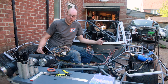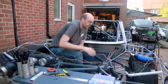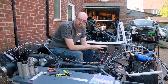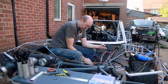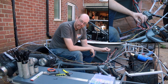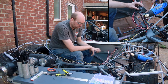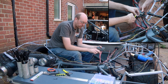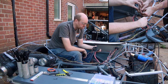It's another morning and we've done pretty well unbundling everything. All the lights on this side can be shortened down, another run goes off to the passenger side, and there's wiring for the washer jets. The main thing we need to splice in and shorten is this big bundle for the fan control block. This used to live next to the battery, so we've run an extra big power line back to the battery and need to run another power cable through — that should tidy up the front of the loom really nicely.